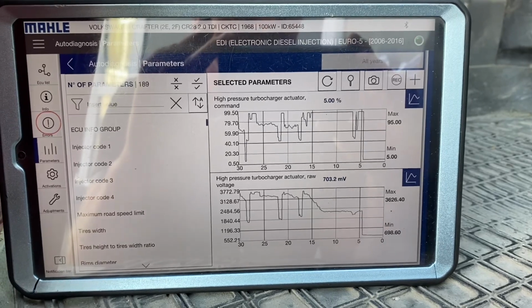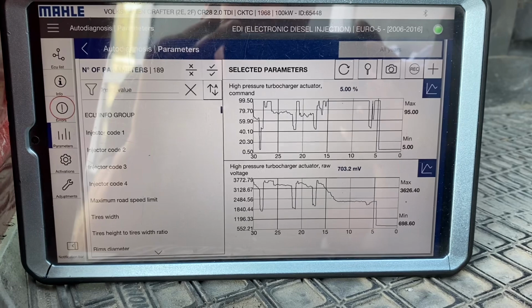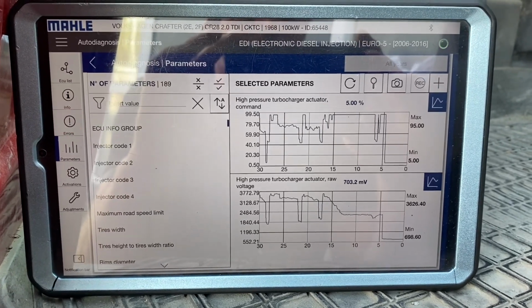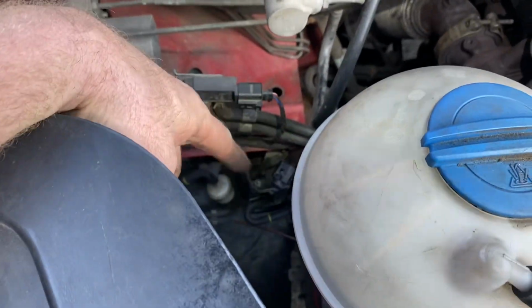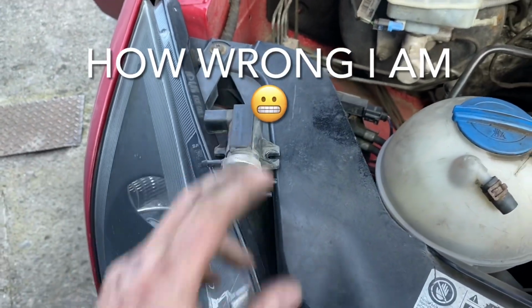Okay, we're on a path to getting somewhere. Now is it, as we said there, vacuum or N75 solenoid? That will have to pinpoint, prove, and see where we're at. More tests. Okay, the two options I have. Option one is just make sure I have vacuum coming to it. I don't believe we have an issue with vacuum. I'm hoping that it's going to be this solenoid.